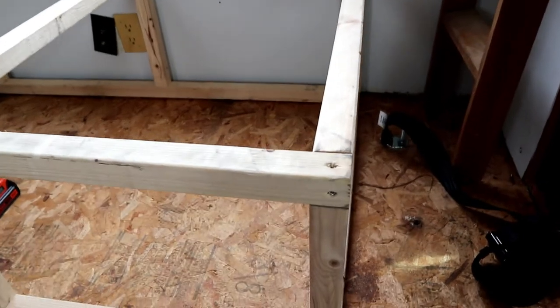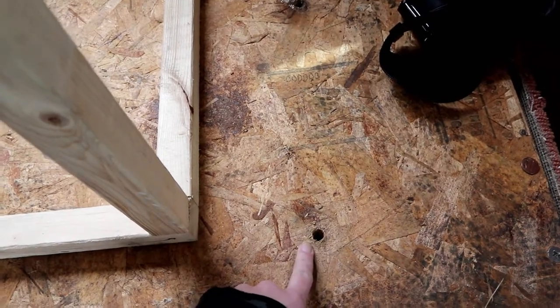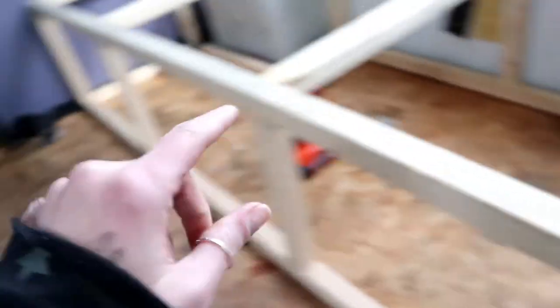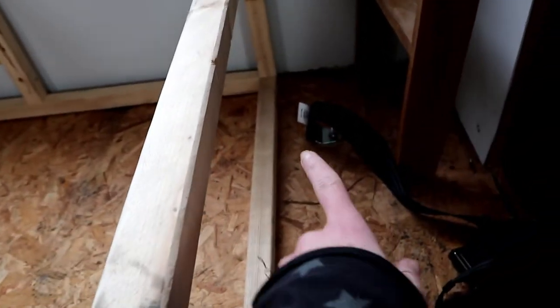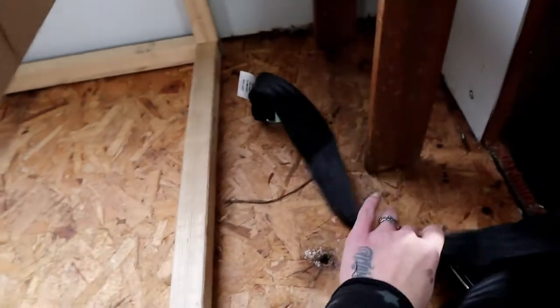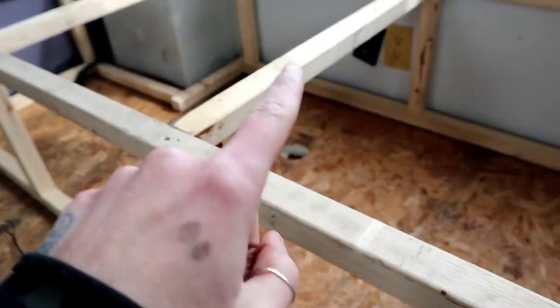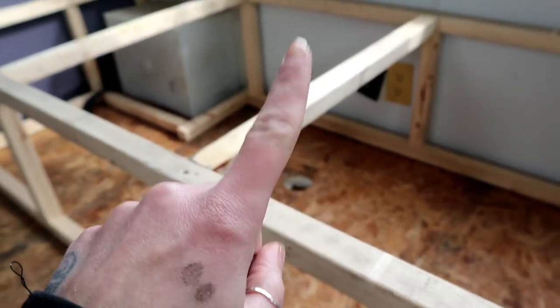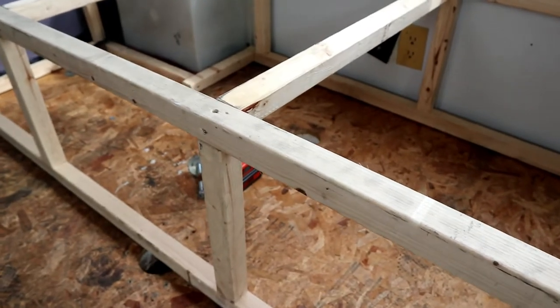So originally there was a little banquette in here, and there were seat belts attached to the floor through these holes, one here, one there, and then two on that side as well. And that doesn't quite work for this kind of seating arrangement, so I am going to reuse this hole here, which already has the seatbelt bolted. Same with one back there in that corner. And I have to make a new hole here in the center for the center seatbelts. So I'm definitely gonna be doing that right now.